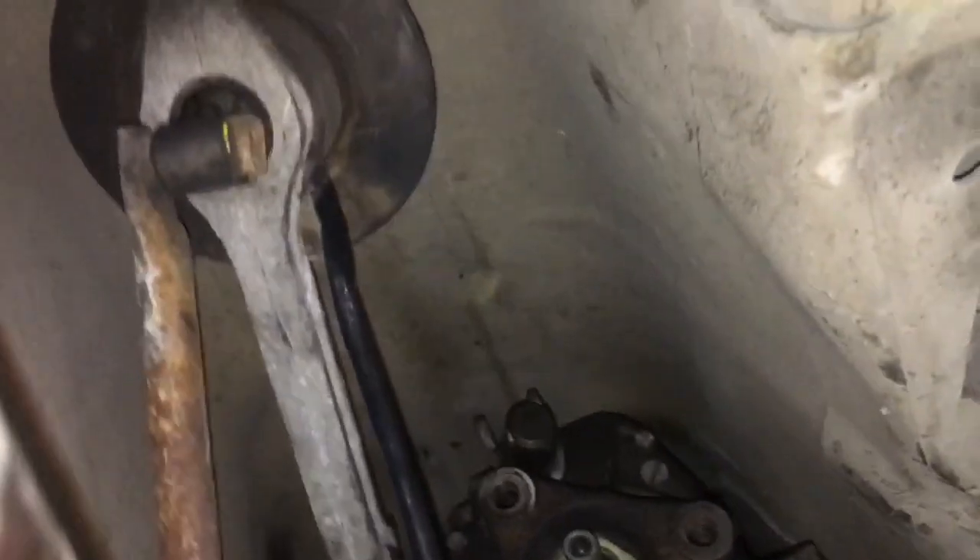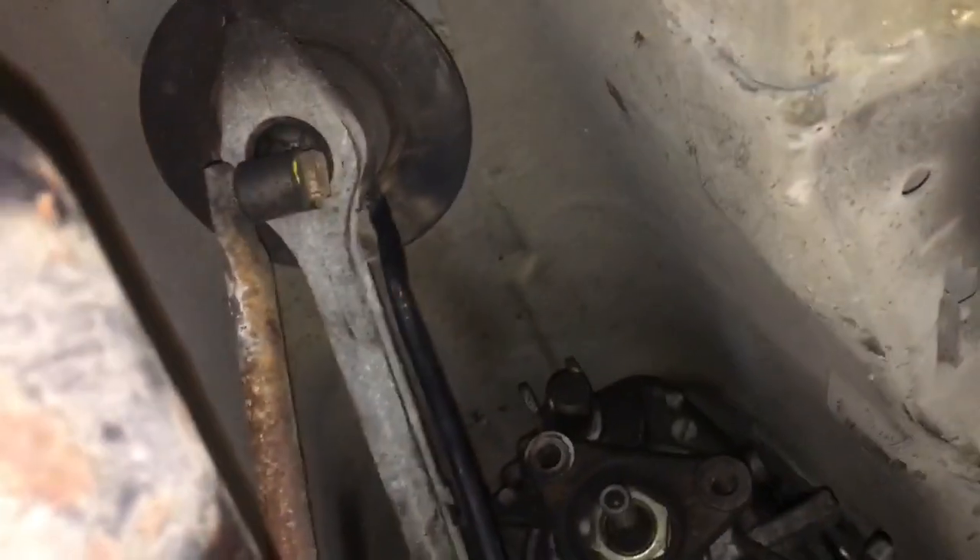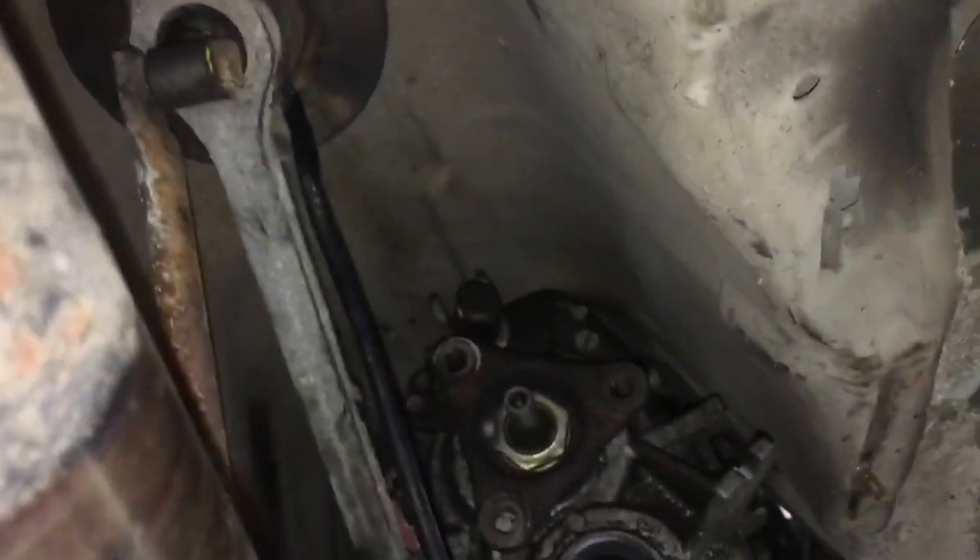Coming back to the transmission, there wasn't anything to it. I did pull it back off to double check everything, but as you can see it's sitting happy. All it took was just tightening it down back and forth, side to side, and then it finally popped into the pilot bearing. The shifter linkage installed is not correct, so I'm just going to put it up top, take it out, put the drive shaft in, just so I can set this car back down and keep it mobile in case I need to do a project before this is completely done.